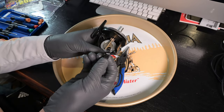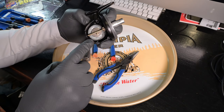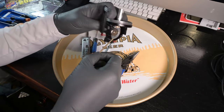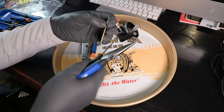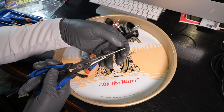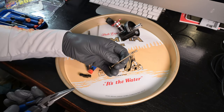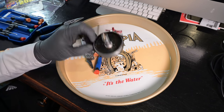The crosswind block pops off. On the back side there's a little channel, and that's what this little cam goes in — that's what forces the crosswind block up and down. Now the main shaft can come down. Just make sure it's not bent — this one is still looking pretty straight. If you have a better way of doing this, please let me know in the comment section below.